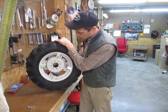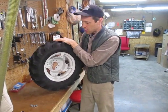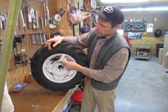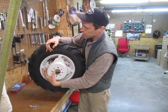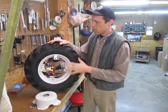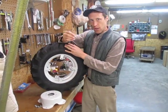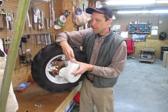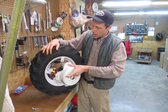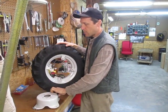I could put this like I had it, which was in from this side. I could invert this thing, turn it inside out, and mount it here — that gives me a different spacing. Or I could put it here inside out, or I could put it here. So you've got four variations. And on top of that, you can get creative. If you want to adjust the wheels just a little bit — like a half inch or a quarter inch on each side — you can use a slightly longer bolt and stack up some washers between the two components. If I went to the hardware store and got a longer bolt, I could put four or five flat washers on each one before making it back together, simply providing spacers to change the rim spacing just a little bit.